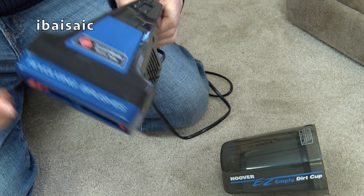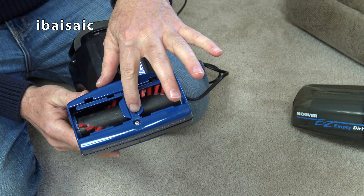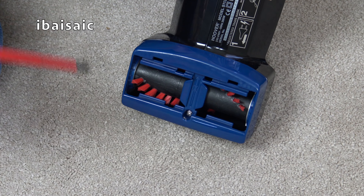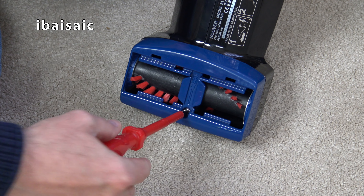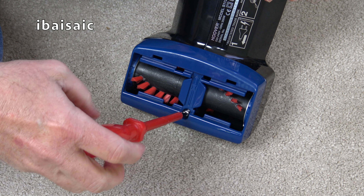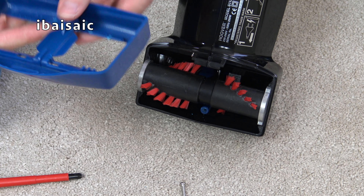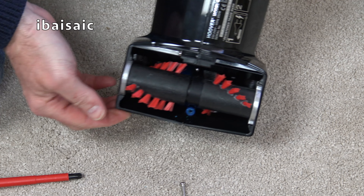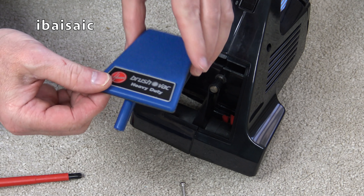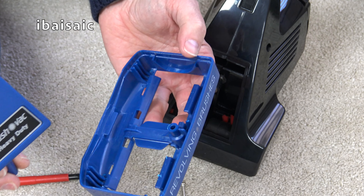I'll have a look at the brush roll and the belt. To change the belt, we just have one screw here, and it needs really a Phillips or PosiDrive type screwdriver. The flathead screwdriver didn't work, but now I've got the correct screwdriver. There we go - the base plate comes off. I'm just seeing if there's a date wheel on this - no. Now we've taken the base plate off, we can also take the front panel off, because that's where the screw goes in. It only needs one screw and both items come off. Very Hoover Junior-esque, isn't it, the way that the belt fits on.